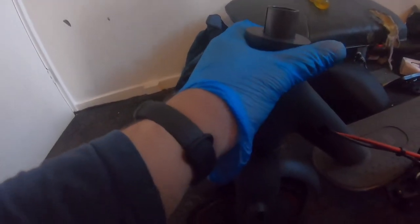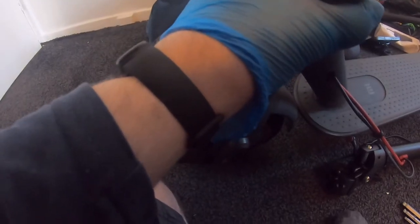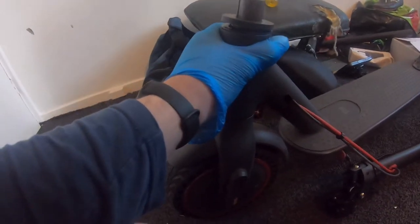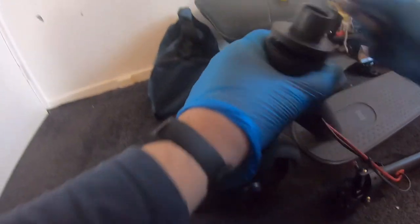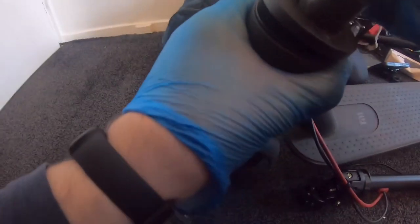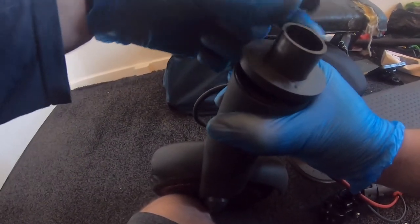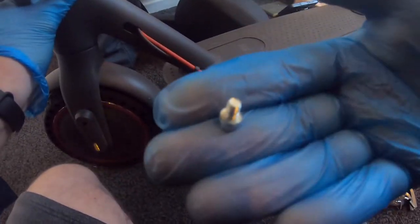Okay, so I'll put the main bolt to one side. Now we need to undo this little nut here, which I'm guessing is about 3mm — smaller Allen key. Hopefully I've got the right one here. Nope — there's an Allen key up there, let's try this one. There we go, that's the one. So that screw comes out. I'm sure those bearings are snapped or there's one missing — or there could even be more than one missing. We take that screw out and I'm placing everything down in order, starting with the head stem bolt, then that one next to it.